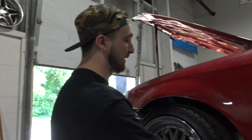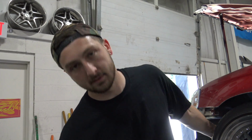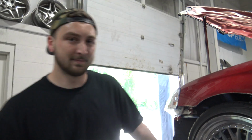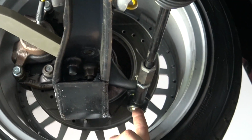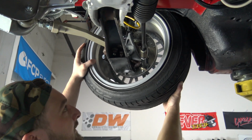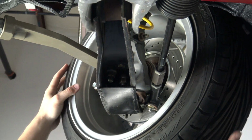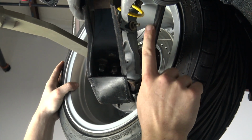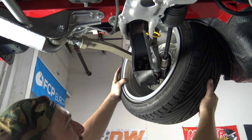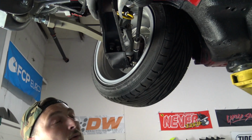And on top of that, we're having this issue called over centering. And well, let me show you what that is. So check this out. We have the steering rack with the tie rod, and then we have the knuckle right here, right? As the rack goes in deeper, the wheel turns, right? If you go too far, there becomes this point where the wheel can actually turn without the rack going in any deeper. There's this movement right here that the steering rack has no control over. At full lock, your wheel will actually start to bounce around inside that play. And of course, that does not feel good. It can cause some pretty weird feeling, and of course, not give you the best control.